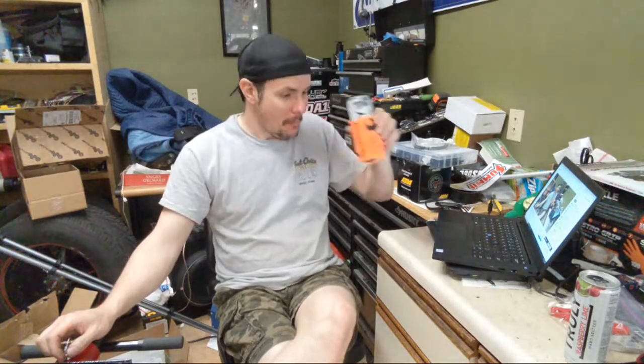Same ordeal. I broke down against my better judgment and bought an engine pre-luber. It's basically an air tank with a hose attached to it. But I've got too much money in this motor not to do everything right. I'm trying to set myself up for success, not failure. Normally I wouldn't care, except that I left the factory crank bearings in there. I didn't pull the caps, so everything else has got plenty of assembly lube on it. Assembly lube oil everywhere. This thing's going to smoke like a bastard for a while till everything burns off.